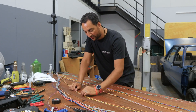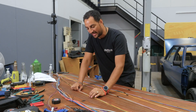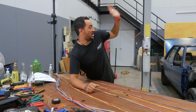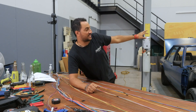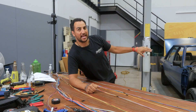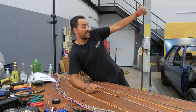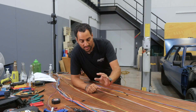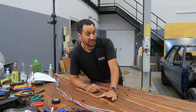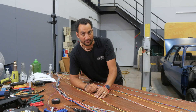Next, I've got the fuel pressure and the flex fuel sensor. They're grouped separately because in this particular car the fuel reg and the pressure sensor are right over the other side and I don't want the dump pipe anywhere near my wiring. It just makes it a lot easier to keep it away from the heat, and I'll actually route that from the inside through the fender to make it a little bit more neat. I'm going to do a bit more research about the routing of these particular wires first before I commit to going ahead.